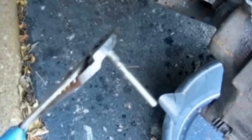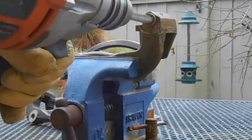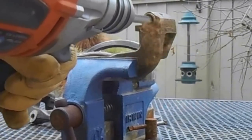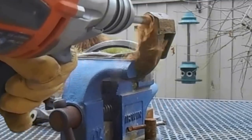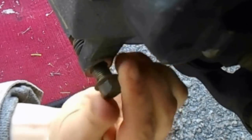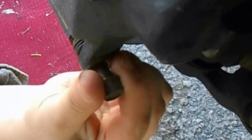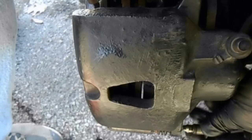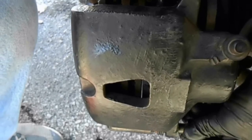Notice also the lack of rust. The pin was stuck and yet the surface was clean and lubricated. The rust was behind the pin's rubber sleeve, which had to be removed, wire brushed, and filed. Now this is how easily the pin should come out. This is the same caliper pin after the brakes had been overhauled — I can pull them out easily by hand.